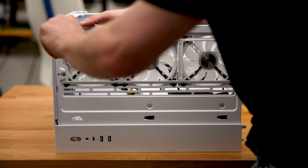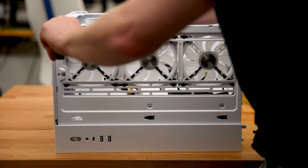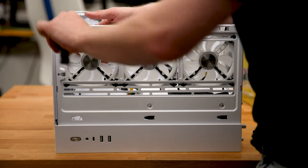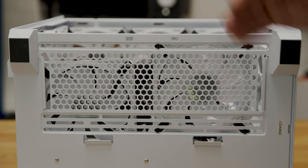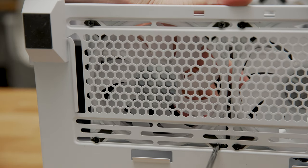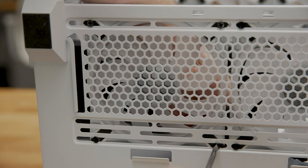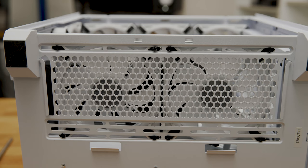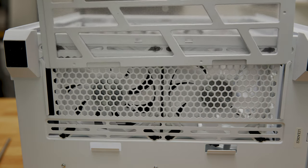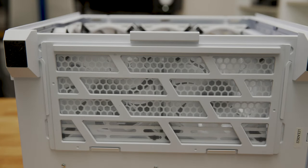Same deal with the top fans — I've got three 120mm fans that I'm going to install as exhaust so I've got the grill facing upwards out of the case to expel all that hot air. For the bottom of the case I've got two 140mm fans that are going to be used as intakes for the GPU, so the open side should be facing downwards to draw cool air in from the bottom of the case. Don't forget you'll need to remove the dust filter to access those fans — luckily it slides in and out of the bottom of the case fairly easily, so don't forget to put it back once the fans are installed.